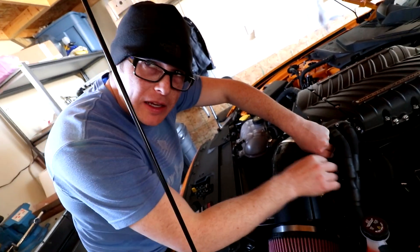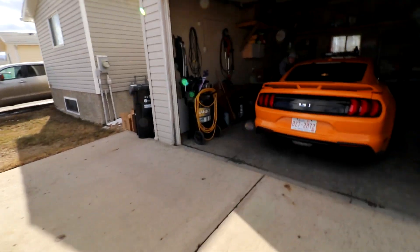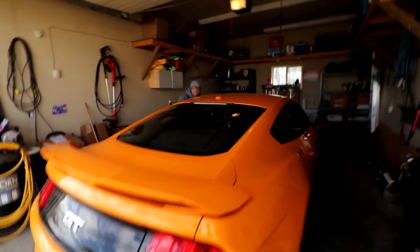We take the throttle body back off. Back a week later — exactly a week later. The throttle body's back and the Frenchman is sleeping, so we've got to push this outside. We need to do a 2,000 to 4,500 RPM pull at wide open throttle.